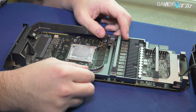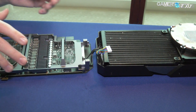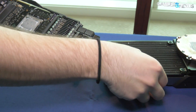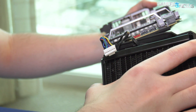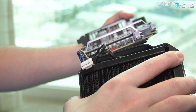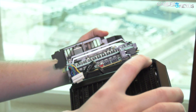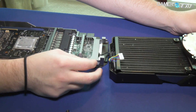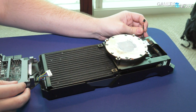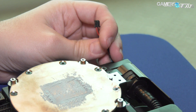On the rest of it, it's all pretty familiar. On the right side, we still have the fan hookups — two four-pin fan headers in there. It looks like an RGB header in there, 12-volt, with GRB as the pinout on that, and then a cable for probably the pump or the fans on the shroud. There's another cable we've already disconnected on this side. This one right here is for the pump — there's your power and ground. Again, this is a non-final design, so that's your hookup for the pump.